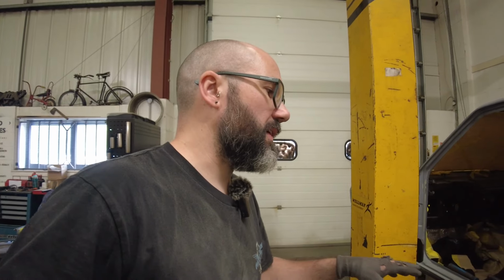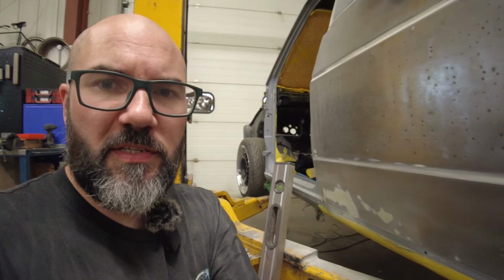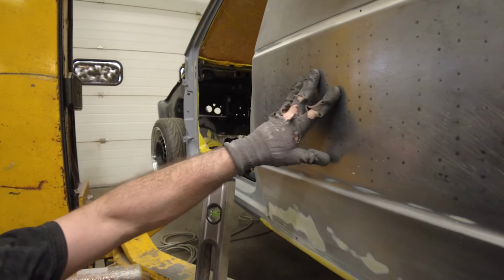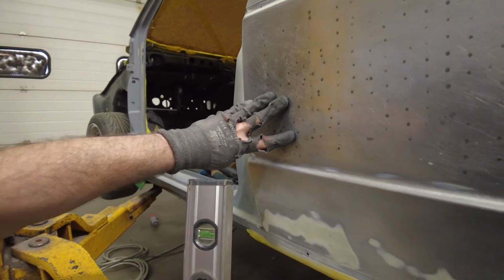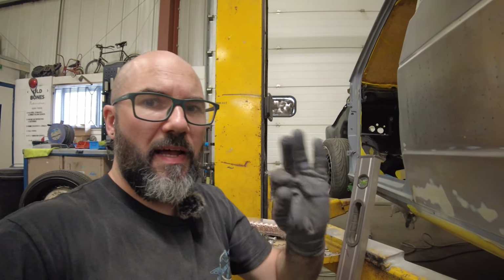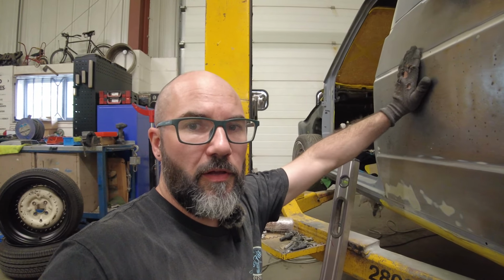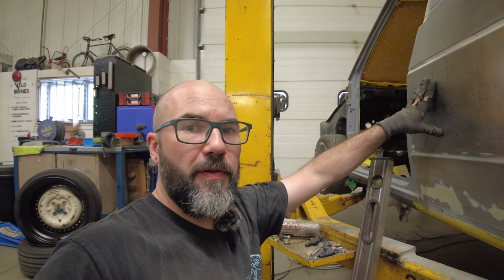So I've left it a few minutes now. Let's go back and check the panel where I've heat shrunk it a bit more and see if it's tightened itself up now. Perfect, that's absolutely spot on. What we're going to do before going on with product is put this on a low bake cycle. So put it in the oven on low bake for about half an hour and just see what happens to the metal, see if it moves, pops or anything like that.